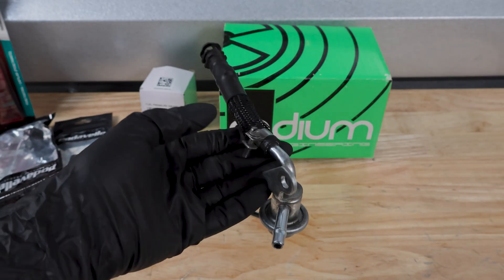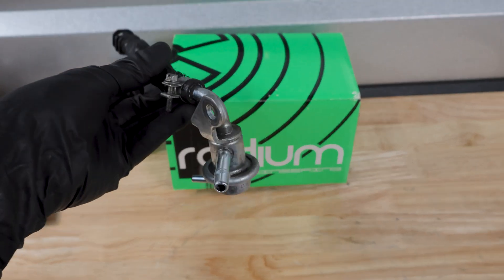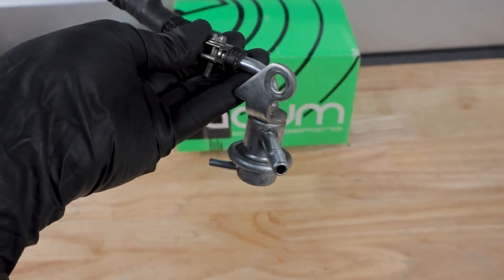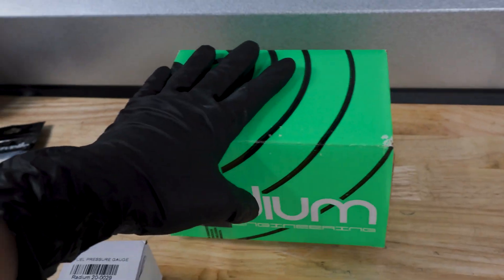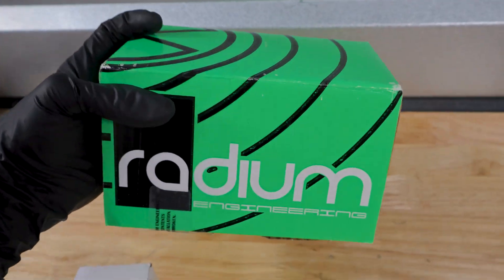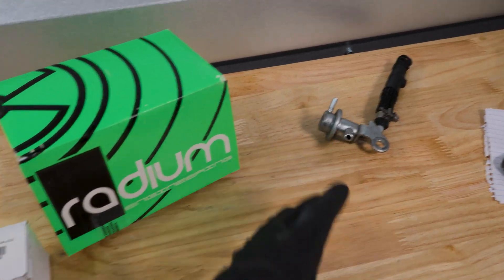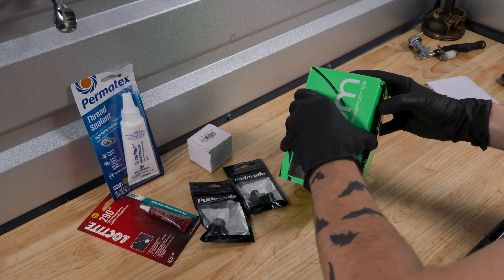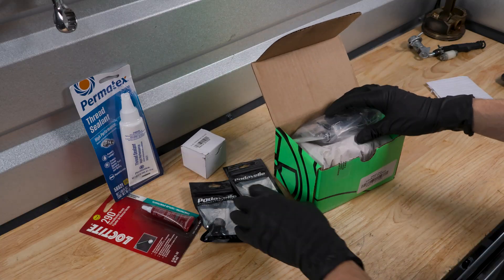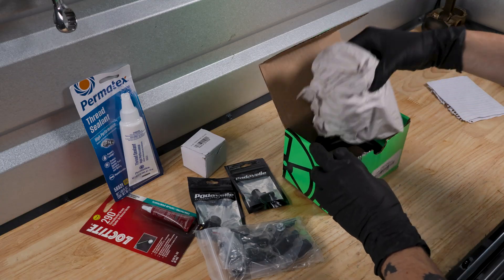Just to give you a better look at what the Cobb fuel pressure regulator looks like: you have the line to the return to the firewall back here, it goes down, goes out this port, back to the flex fuel kit, then goes to the rails, and the bottom port is for vacuum. Now it's time for the fun stuff — this is something I've been wanting to do for the STI for a very long time. I just didn't have the money, that's why I stuck with the simple Cobb fuel pressure regulator. Hopefully we have everything we need and I don't have to go to the store.